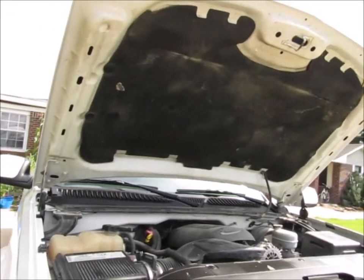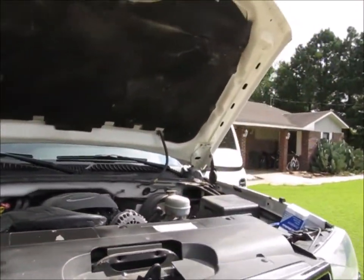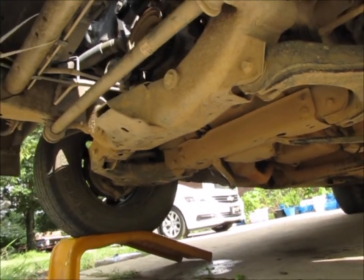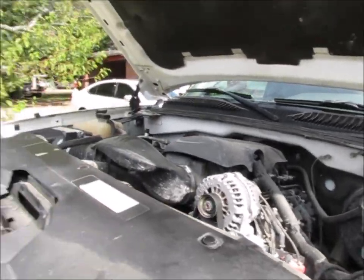Let's go ahead and start her up. You want to listen and make sure the engine is not making any weird noises — and it sounds pretty smooth. You also want to look underneath and make sure the oil filter is not leaking and the drain plug is not leaking. Everything sounds good, so I think we're going to call that a successful oil change. I'm also going to go ahead and lubricate the upper and lower ball joints while I'm down underneath the truck. It is important that if your vehicle has grease fittings, most people do the lubrication cycle at the same time as the oil change, so your ball joints and tie rod ends last a long time.